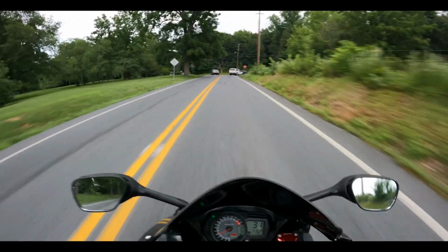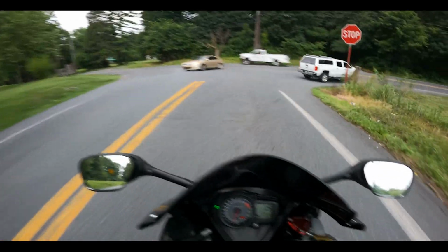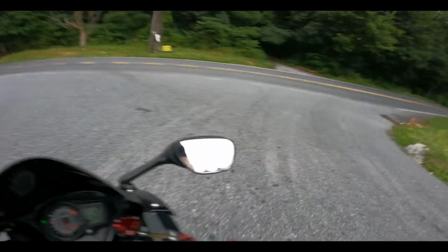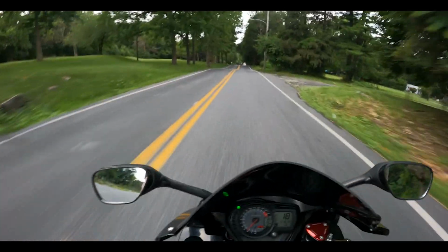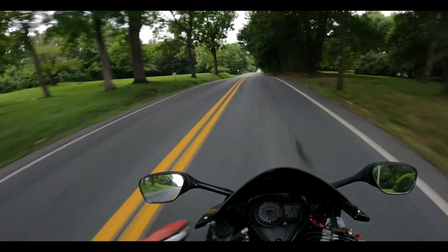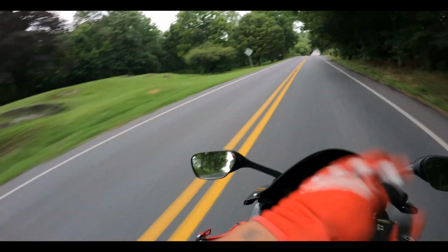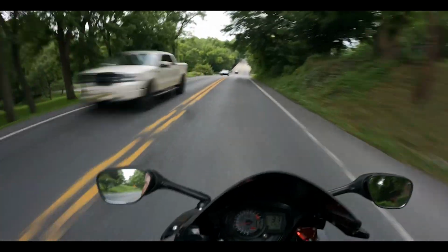It's a grippy tire. It's good for circuit racing. It's just not meant to go riding around cruising with your friends. That's not the type of tire this is. It is a terrible tire for miles, and it's expensive, but you get what you paid for, and it is the best. Now, don't get me wrong, you don't have to go with Pirellis to get these type of tires where it leans over. If you want those tires to go circuit racing, get yourself a 190/55/17, and it's going to give you that lean angle. That's for the rear. The front ones are going to stay the same.